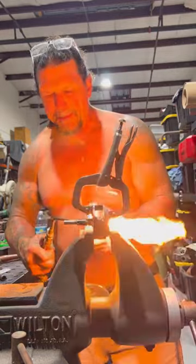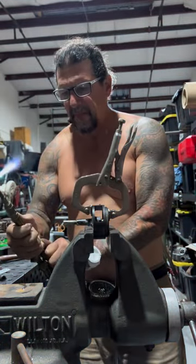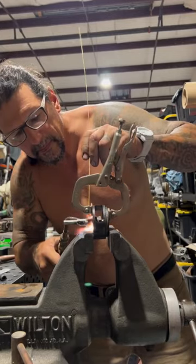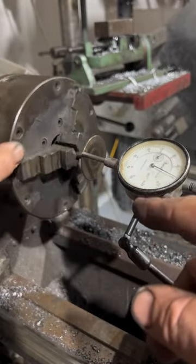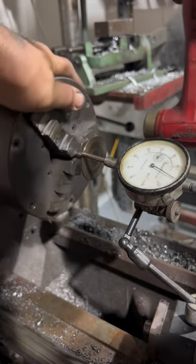This is how you fix stuff in a pinch. Exactly five thousandths of valve runout — the valve got bent from all this trauma inside the engine. I'm just gonna love it a little bit with this brass hammer.